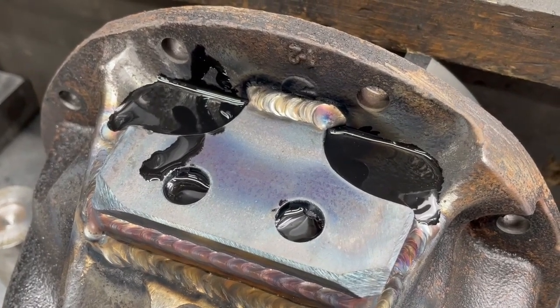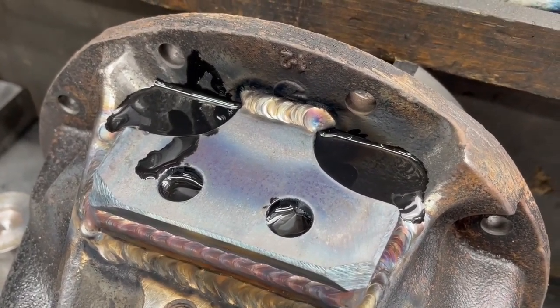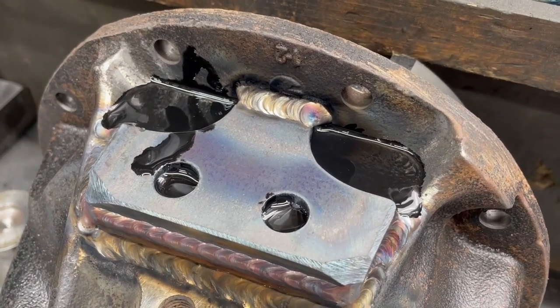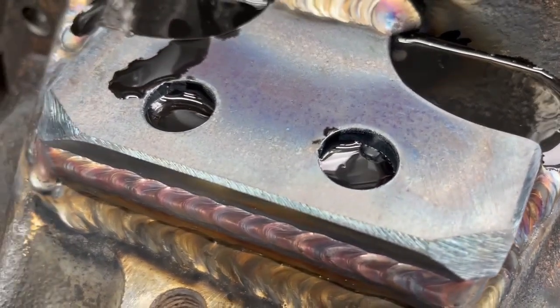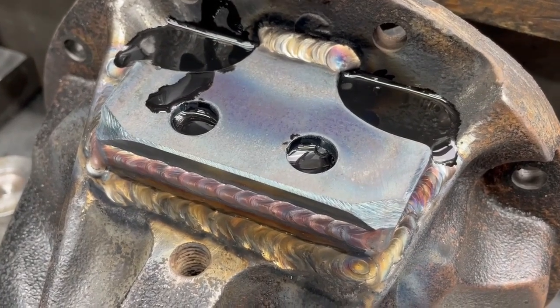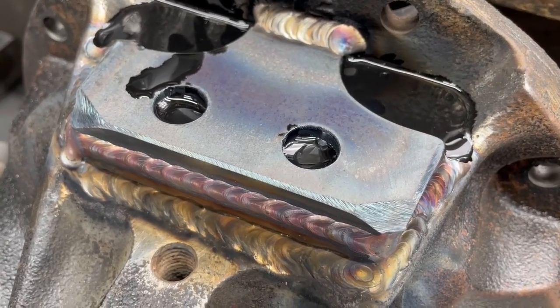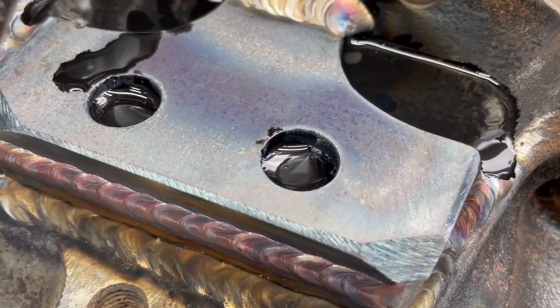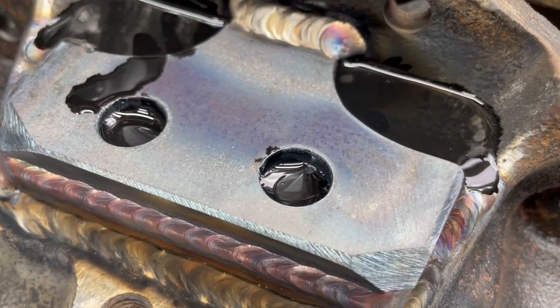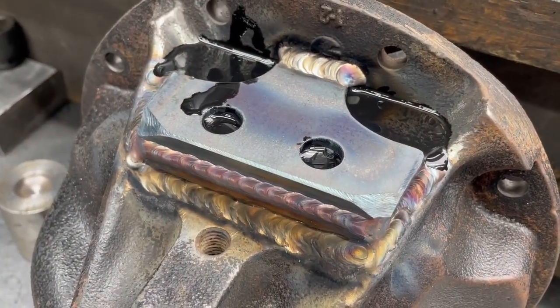The resin comes in two colours — black and clear, this is black. It expels any air that's in the cavity between all the various plates in the casing. So when this has gone off and we drill through and tap it, those two holes are completely sealed from the rest of the diff. The only way oil can leak out is if you actually break the welds, or you get the capillary reaction of the bolt on the right hand side being under oil, working its way down the thread and out. We stop that by putting a special RTV sealant on the peg bolts when they go in.